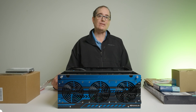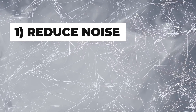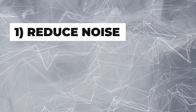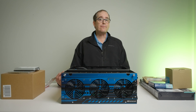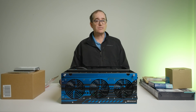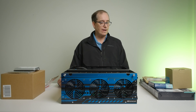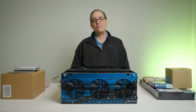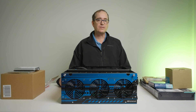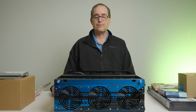There are a few things I need to change. First and foremost, it's just too loud for my condo. I live in a pretty small condo with my wife and I don't have a place to stick this thing where it can be loud. So I've got a few things I'm going to try to make it a little bit quieter — some resistors to slow the existing fans, some replacement fans, and I also have some Dynamat. If the resistors are enough, that's probably as far as I'll go.